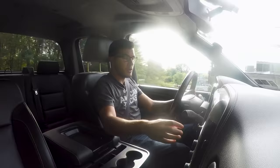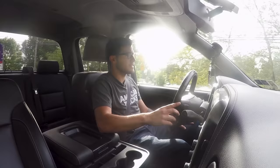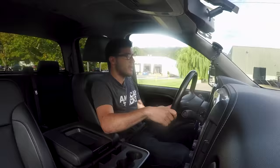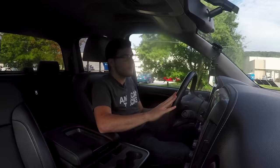We are loaded up in my 2014 with the 3.75-inch lift and 35s. Driving completely straight on this lift — no rubbing at all. But you can hear that — same exact tires, just two inches taller, and they are noticeably louder. I'm going to make a left at this light and see how it handles the turn. That handled pretty well, but now I've got a tighter turn coming up that'll probably be full lock. There it is — it's actually resisting the steering wheel. I can't even accelerate because the nubs on that tire are just catching the chin spoiler, and it rubs so hard in the wheel well that it actually slows your acceleration down.